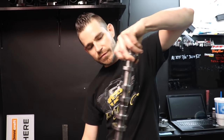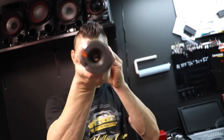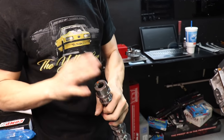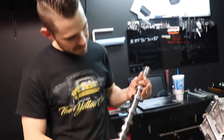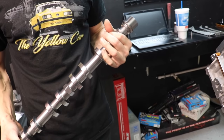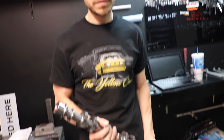These are actually cleaner than normal. Be careful — sometimes the lobes are super sharp on the edges. They are gun-drilled, so you can see completely through them. That portion needs to be cleaned — you should wash off any residual rust inhibitor before we put them in the engine. I'm going to get the rest unpacked, wash them real quick, and then start putting them in the head.